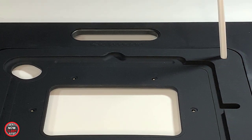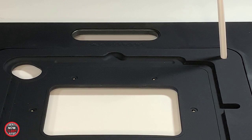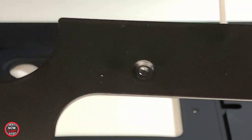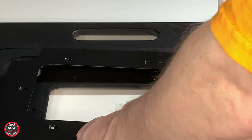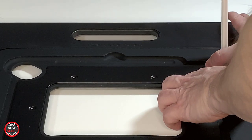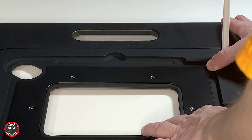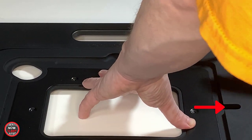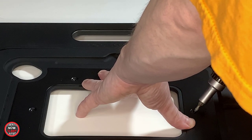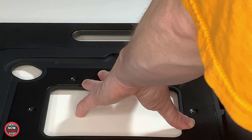The initial adjustment is very important. You can see it's leaning over, so we know it's completely off at this point. You see that tug in the corner? Once I pulled on that, you notice the pen went straight up — that's obviously what we want. Don't worry about the Apple Pencil being straight just yet; we need to put the magnet back in. The holes on the metal magnet are sort of recessed into the rubber insert — that's what holds it all together. We're going to get these holes lined up and press down with a little bit of pressure. We're going to use that rightmost middle screw as an anchor for our initial adjustments. What I'm doing with my right hand — which you can't quite see — is pulling where the charging cable comes in to the right, making sure I'm pulling the entire insert as far right as I can as I put that screw in.